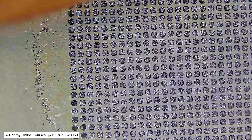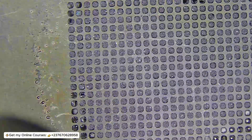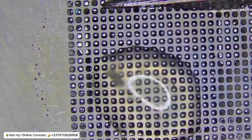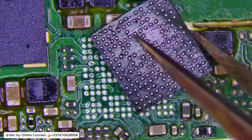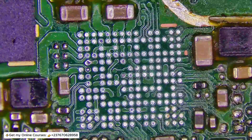If it's the original stencil for the IC, it won't be as complicated — especially if you're just starting. But with a universal stencil, you need a lot of practice before you can do it well. As you can see what I'm doing — all good. I always apply paste to make sure all the pins are connected, because with this type of stencil you'll notice some things may not connect when removing it. Here the IC is ready to mount, and we'll do that slowly.